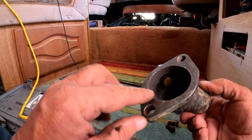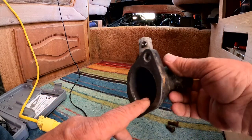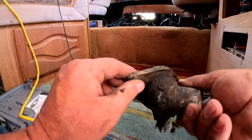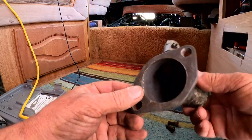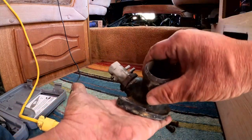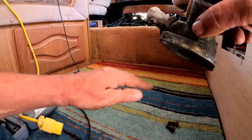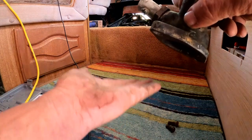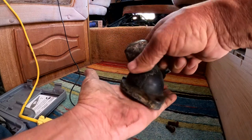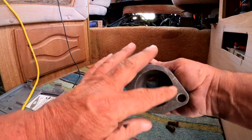You can lap that in a little bit too. You sometimes get warped surfaces, not that it's the end of the world. That's what the gaskets and gasket sealers are for, to account for a little bit of poor surface area, warped or pits, that sort of thing. But then, these can be put on a lapping plate. Some of you might know what that is. A nice precision plate with medium to fine sandpaper face up, and you move it this way and rotate. There's a process to lapping, making something flat again, and the shine, your marks will show up, the high spots.